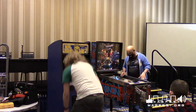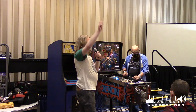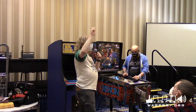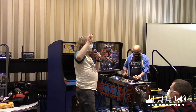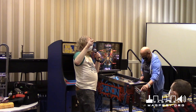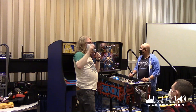But yeah, the last thing I will tell you before we end this and take any final questions is replace your pinballs. They knock against stuff, they get damaged, and as they get damaged, they can hurt the playfield. Yep. So replace your pinballs. It seems like a silly thing, but when you get that first pinball machine, the first thing you should do is go online, go to a place like Marco or any of the other pinball companies, and buy new pinballs. They're shiny, they'll look good in your game, and they'll protect it.